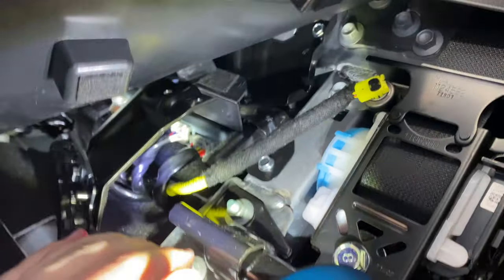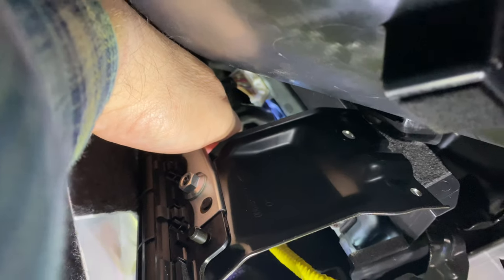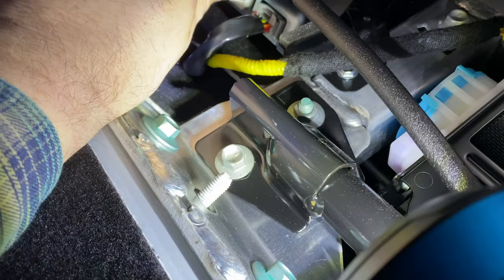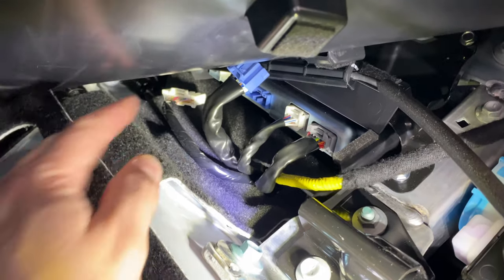Making good progress — I can flip this up underneath and that's the money right there. The two plugs we're concerned about are right in the back. There's one, and there it is over here just inserted back there — that's the white one. That's where you'll be working, so take both of those out. Quick update: this metal piece right there — I found it much easier to just stuff it up there. It fits way better than trying to spin it in this space like the instructions say. Don't do that — just stuff it up in there, takes half a second.